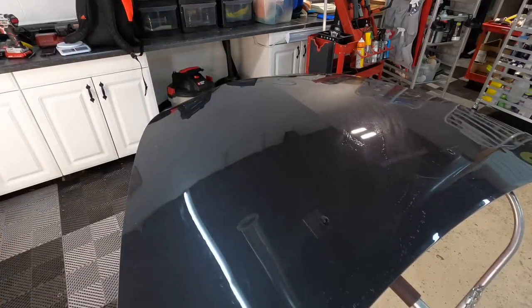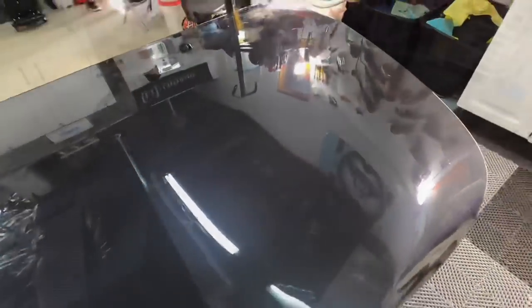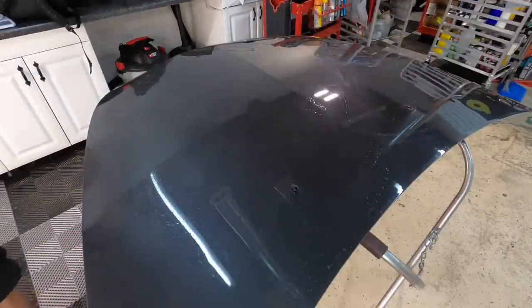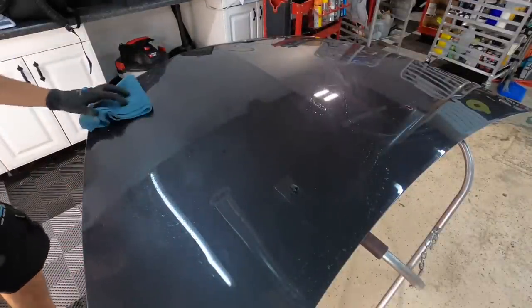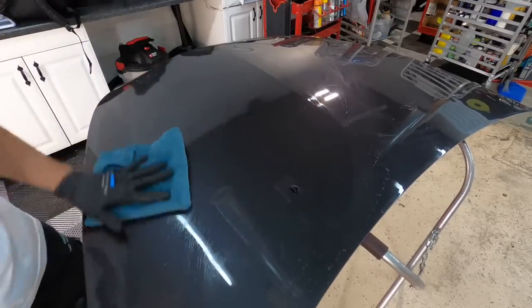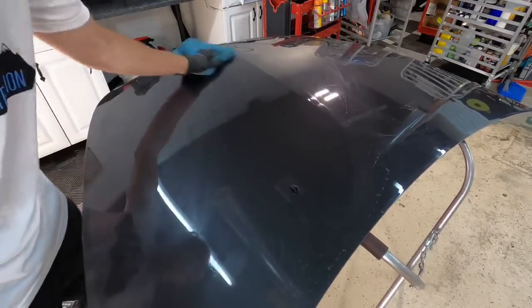By the way, coatings will add microns to the surface of your panels, not mils. Unless you're adding a 12-layer coating system, you're not going to reach the mils. It's just maybe 5 microns, 10 microns or so. There is a lot of misinformation out there, and that is definitely one of them.